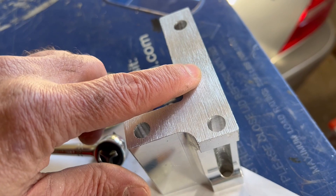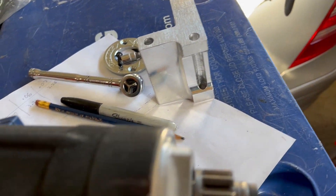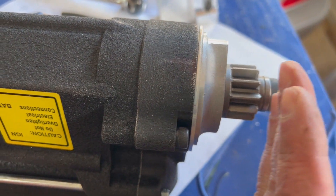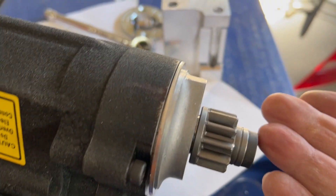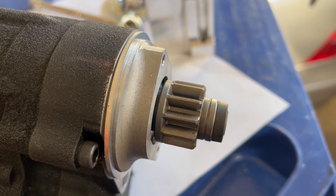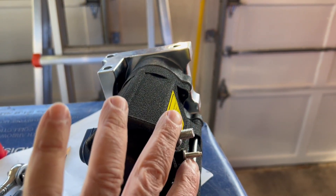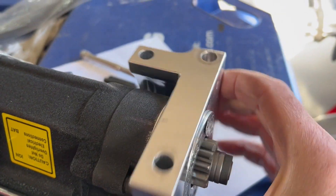I got 100 thousandths milled off - I was using a number 36 grit sanding belt. Here's the spacer ring that you can adjust in case the gap between the starter pinion and the flywheel isn't correct, but again my gap was 3/16ths and perfect so I'll leave it. Putting this in will move the starter motor up and make the gears mesh tighter. Another feature of this Power Master is that you can rotate the mount bracket to reorient the wire lugs or clear headers.